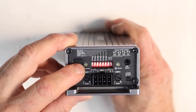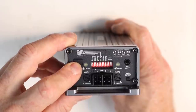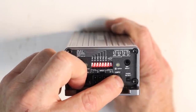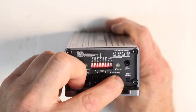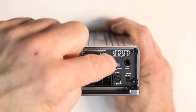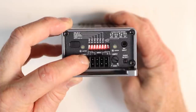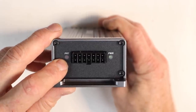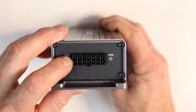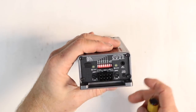Coming down on the amplifier, you see two yellow lights — these are your limiters. It has a form of distortion detection built in, and adjusting the gains will allow you to set that up accurately. Down in the corner where it says radio detect, this is a load resistor built in if your radio requires one — it comes default off, and you need a small screwdriver to push it in if needed. Your microphone will plug in here. This plug is for your input, both high level and low level. On the other side of the amplifier, you have your red protect light and green power light, and this is also where your main power harness and output speakers connect.